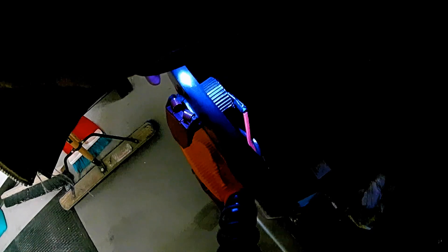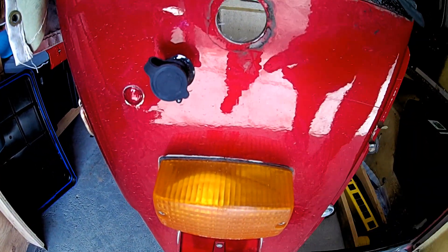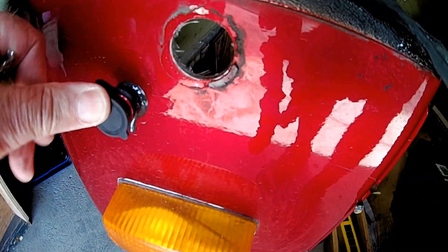It always stuck out too far and got hit by the tent when it was folding down, so it got pretty mashed up. I'm going to disconnect that and put in that new aviation style plug. I'm going to put a voltmeter right here, and then add one more outlet back there. That's the hole where that used to live. I'm putting another hole in — there's my input for the solar panel now. It's held in with both clamp and with some JB Weld, and that's good and strong.